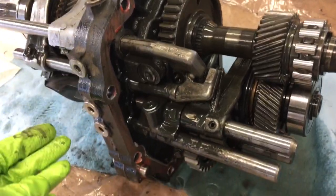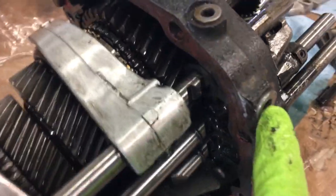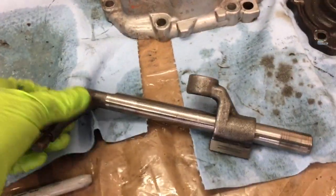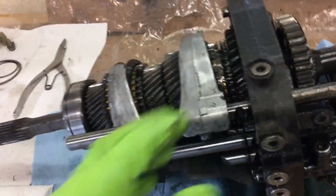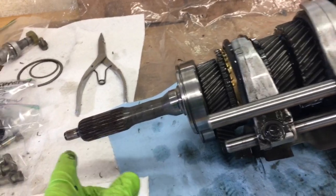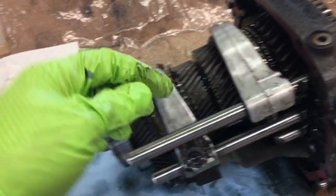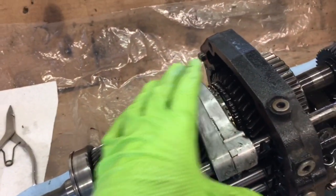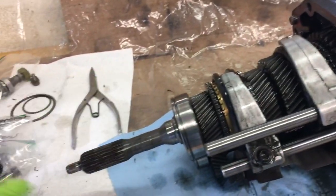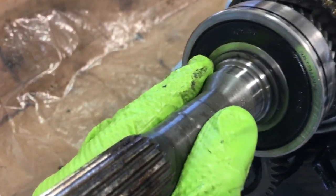A couple of things I wasn't sure about initially: what are these things on the outside? Turns out that's how you access the spring and the detent for the shift levers and shift rods. Now when you crack open the case and take these bolts out on the forward part that goes into the motor, you can just bang the case with a little rubber mallet and it will separate. You can get in with a pry bar and inch the case off.